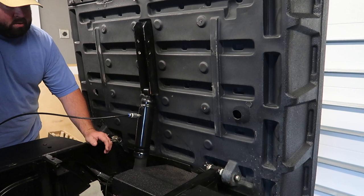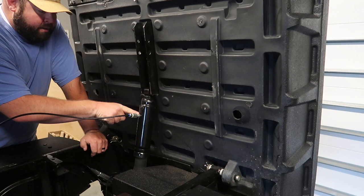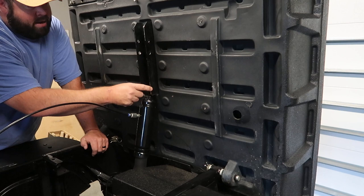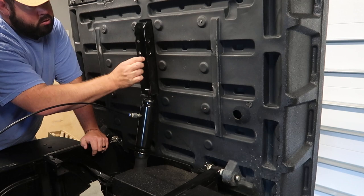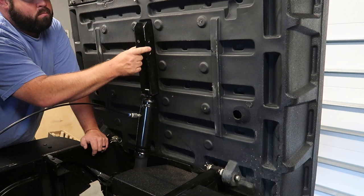So as you're going to see, the shock is now mounted right-side up. I have the fitting in here — it's an adapter. I'll put a link in the description if you have air shocks. It's going from a JIC fitting into a quarter-inch male fitting going to quarter-inch line. I'm going to take this bracket off the bed — it's got six quarter-20 bolts. I'm going to start notching out so we can try to mount it on this lower section here.